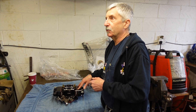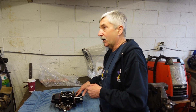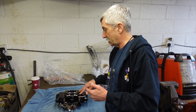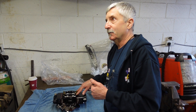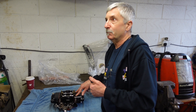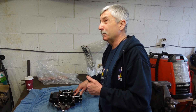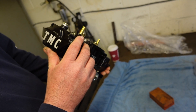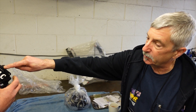The nice thing about the upper jets is you're not relying entirely on the main jets for your entire power range. You can effectively set up the car from the start line to mid-track with the main jets, and then fine-tune the big end with the upper jets by making them bigger or smaller. So it's like a second pair of jets after the main jets.